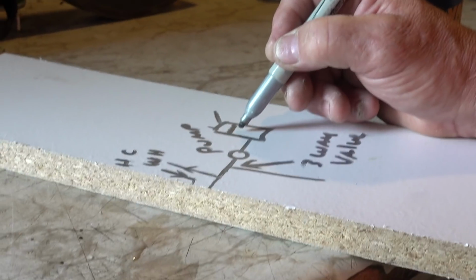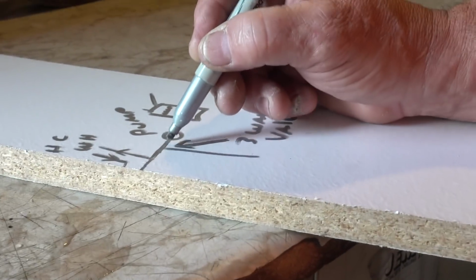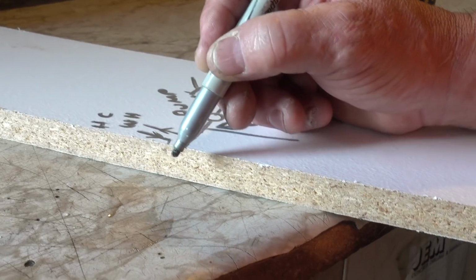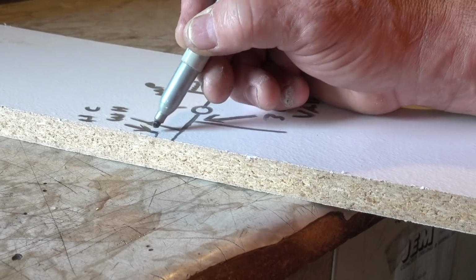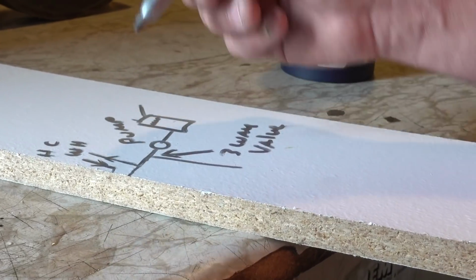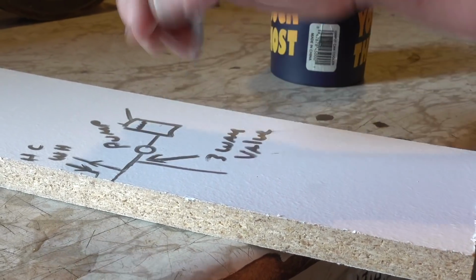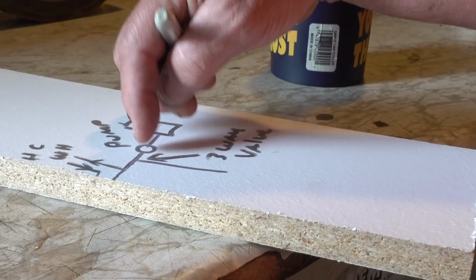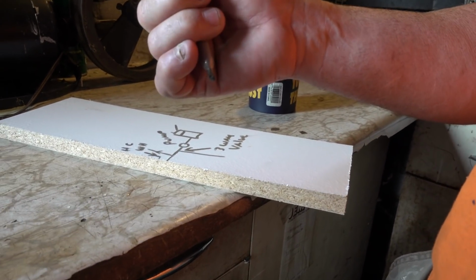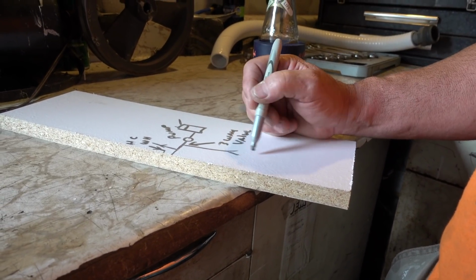Okay, so you fill this and it's full of water, and then you got a pump that pushes water to the water heater and to the two colds. You got a sink and a shower. It goes into the water heater, and then it goes to the 2 hots. You're gonna have 3 colds because you got a toilet. But if you have this 3-way valve, it would be open this way to where the water goes from here to here. When you turn it a 1/4 turn, it closes this way and opens this way, and then this is where your hose goes.